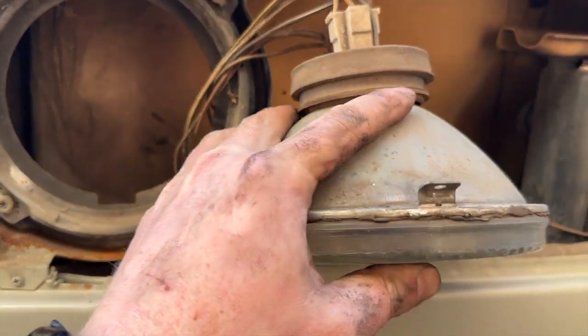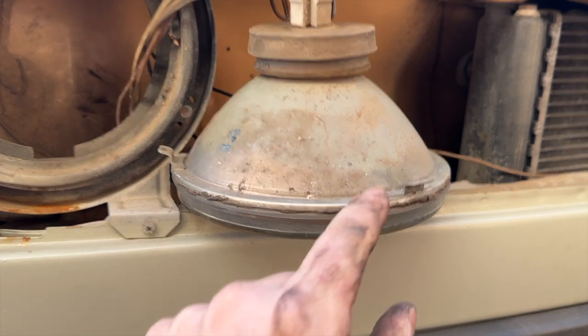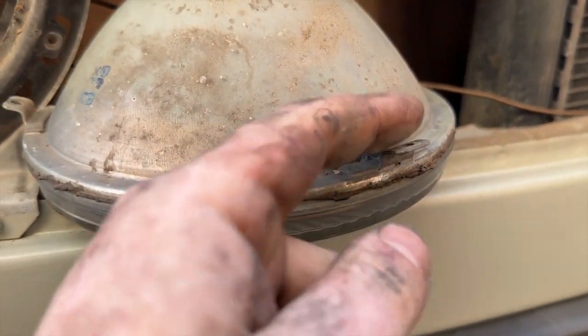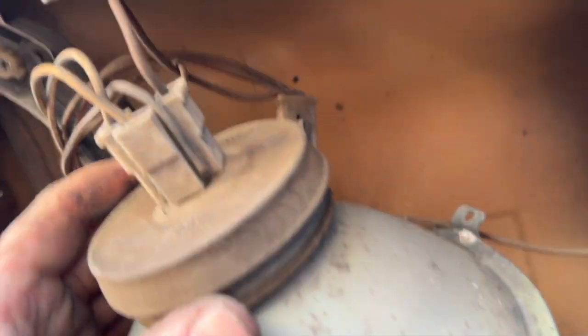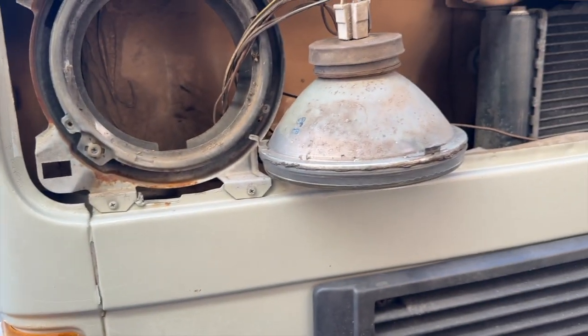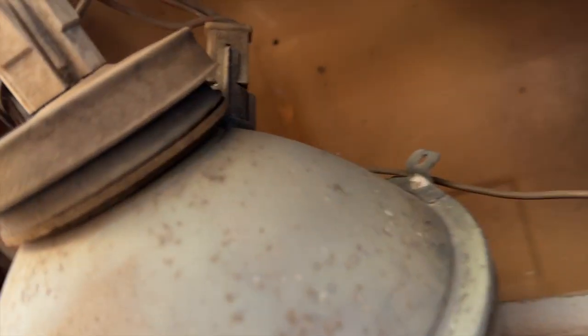We're trying to put LED headlights in here, but taking out these H4s revealed some real weird stuff — someone brazed or soldered on some tabs, so we're missing the outer headlight ring. And what is that? Does this have daytime running lights? That must be what that is — there's a second bulb in here. This is strange.